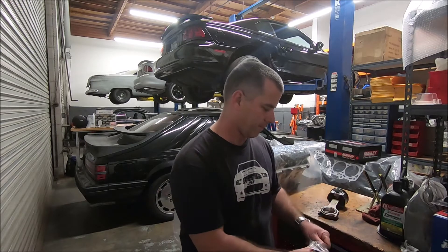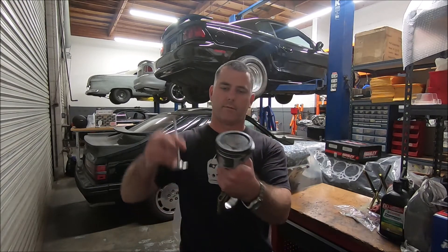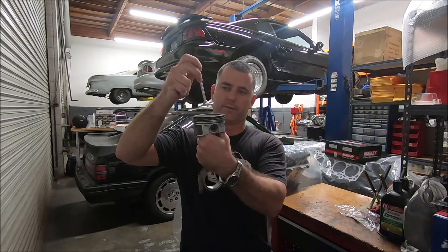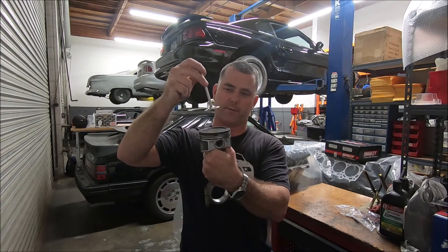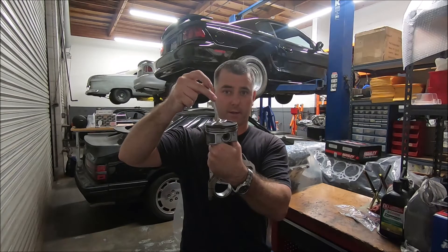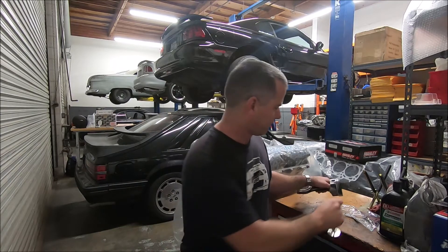In this video I'm going to talk about degreeing camshafts on two and four valve engines - it's the same principle for any engine. What you're doing is trying to control the event of the valves: when they open and close in relation to what the piston is doing. The piston goes down as the valve opens during the intake stroke, then comes back up as the exhaust closes. If you get this wrong you can get piston-to-valve contact, and we don't want that.